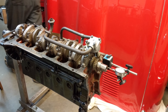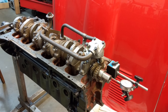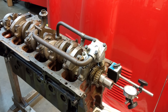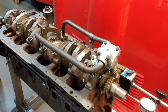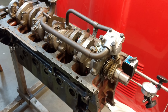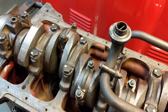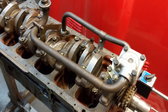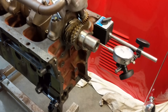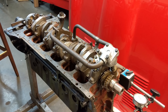That's a total success. That does it for the bottom end of my junk E-Type engine — everything is in place and ready to go. It was somewhat unusual because we used the original oil pump, which is not normal; a customer car would have a new one for sure. Pretty much everything you're looking at is original, exactly how it came off seven months ago — reused all the nuts and washers. The only thing not reused were the old lock tabs, but you can consider this a concourse build. Next episode we'll get to the timing gear and put the oil pan on.